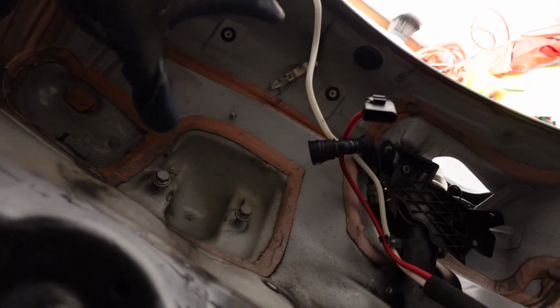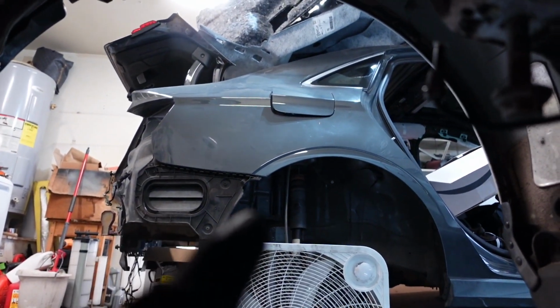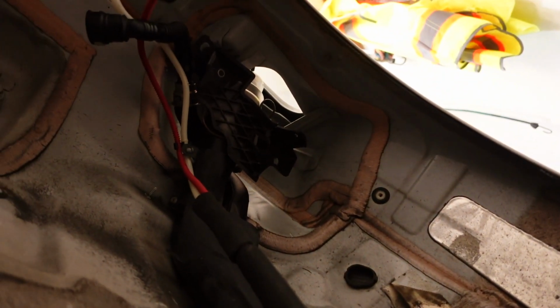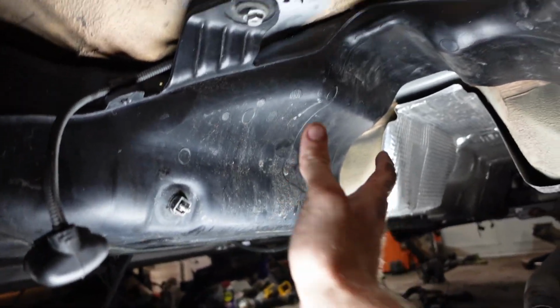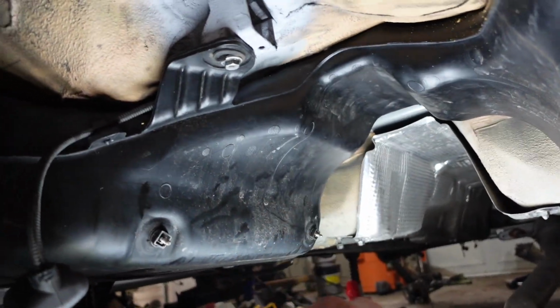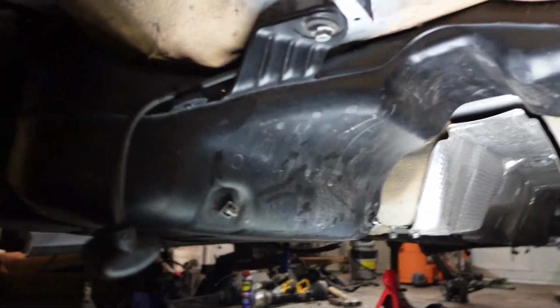After that, I'm going to put the fuel gas emissions breather over here, right there next to the shock. I'm going to bring that one over, hook everything up, bolt up, and we can put the fuel door back in place and call it a day on the fuel tank situation. Of course, before I put anything else on, I'm going to take the heat shield that I took off here so that this is protected from the exhaust. Then go up top and connect wires in the top.